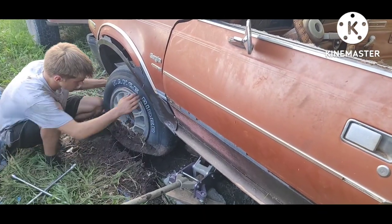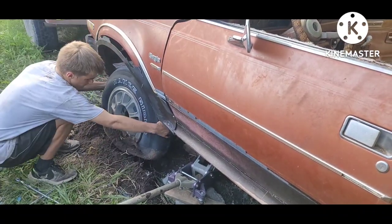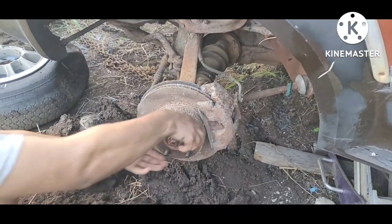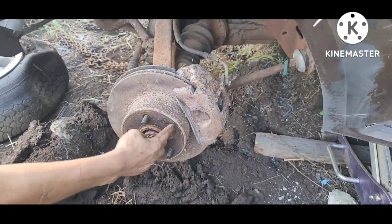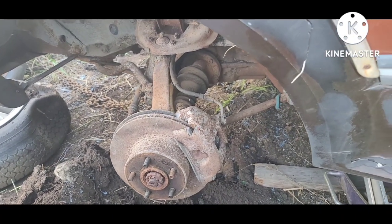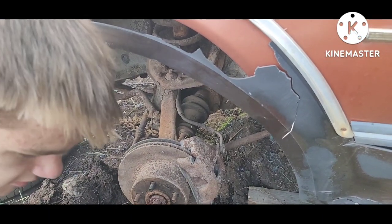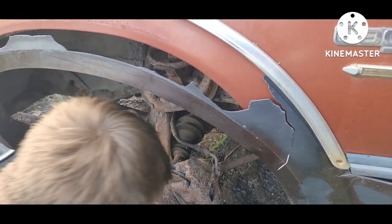Okay. I'm hoping it's not drivetrain because I'm not too knowledgeable on four-wheel. Yeah. Get a bar. It is that rotor. It just has a little bit of play in there. Oh, yeah. Okay, yeah, because it's like an axle. Okay, so look and see how that rotor's held, or that caliper's held on from the back. Maybe we could pry the bar with these lug nuts on here? No, we need to pry the caliper off. Okay. Look on the back and see what the hardware is.